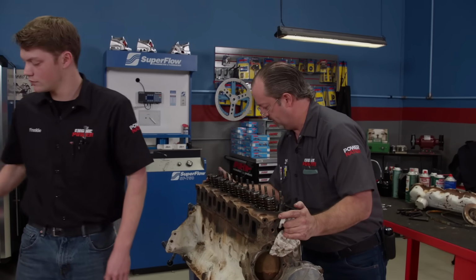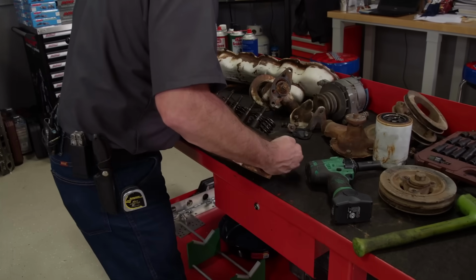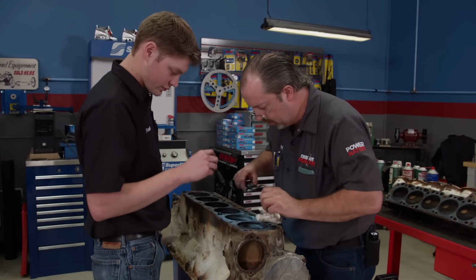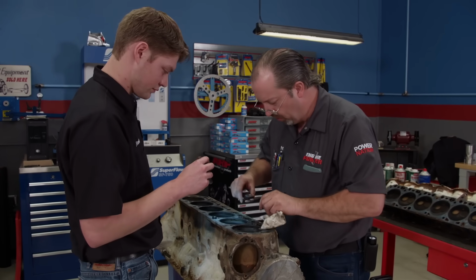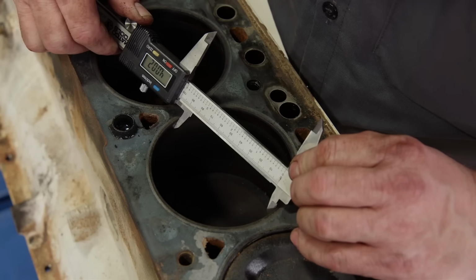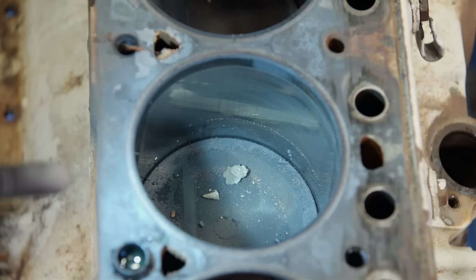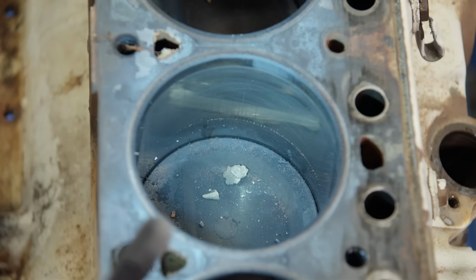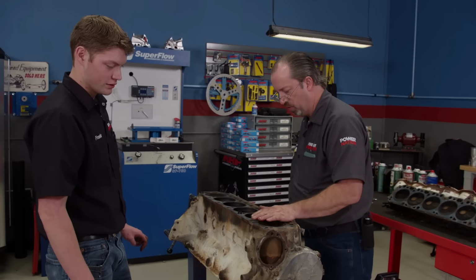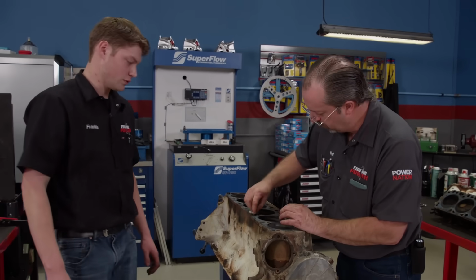Sealed down. Got it from there. Had a little oil on one cylinder. Not bad. So what do you think the over-under is on this thing being stock bore? Well, it's been apart, but maybe, yeah. It is stock bore. Okay, I'll buy that for $1. What were these stock for compression? I think this was 8-to-1. Yeah, it's something low like that. So that will definitely need to be improved on.